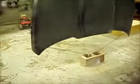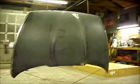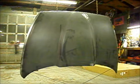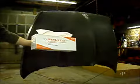I've got the hood hanging. I've got bungee cords going to the floor on a cinder block so I have a little movement — it still moves but not that much. Got both sides scuffed up, ready to rock and roll. I'm going to wipe it down now — put some wax and grease remover on it. I'm going to wipe it down with these handy dandy Wipe All lint-free all-purpose wipes.